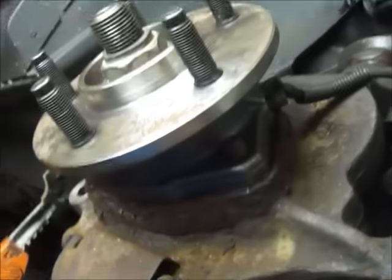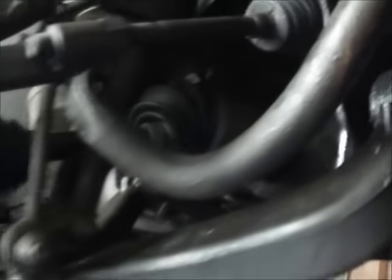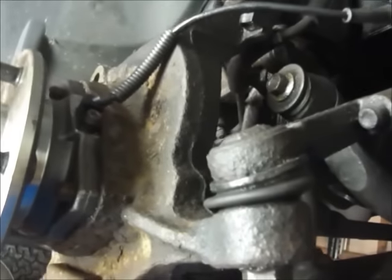This is what was really loose last time — that moved up and down. That's how I could tell when I thought it was a bearing in there, but it turned out there's a spline connection in there and that's what was gone — just worn out. There's the new CV boots, new hub bearing, and I'm glad I replaced it anyway; the other one was probably on its way out. Got the knuckle back on. I actually had to use the spring compressors to take a little tension off to get the fork back onto the strut where it connects to the lower control arm. That was a little bit of a challenge, but after that everything is slapping back together pretty nicely.